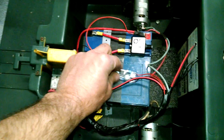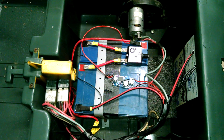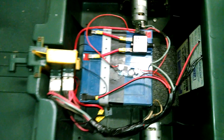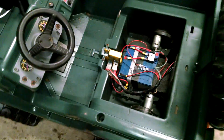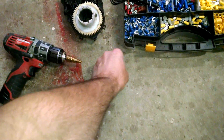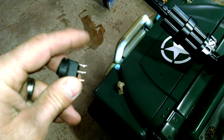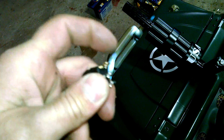What I love about this is you don't need a separate battery and don't have to charge anything extra. This little gizmo is like two dollars. You can tweak the voltage — you can actually turn it up for a bit more brightness, since LEDs run by voltage. We run about 13 volts; it's not going to drastically reduce lifespan. You drill holes, put the lights in, and tap the step-down converter for power. On your lighted rocker switch, the brass is always your ground, the outside is power in, and when power is on it lights the LED and feeds power out through the middle terminal to your accessory lights.